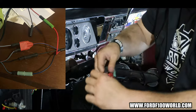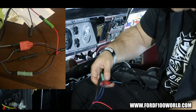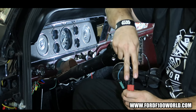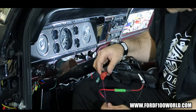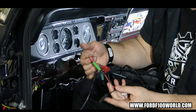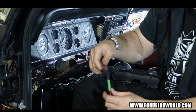On the extension, black goes to black, and blue with black line goes to blue with black line — kind of makes sense. Then down here you have two blue with red lines and this boot on your extension with three holes, but you use each side. Over here is the tack — all you have is red and black. The red wire goes to red — makes sense. The black one is your tack wire, and the black goes to your coil. So there you go.